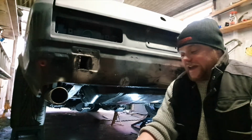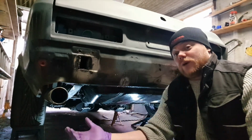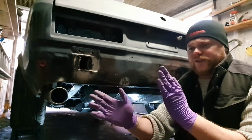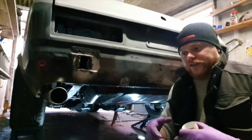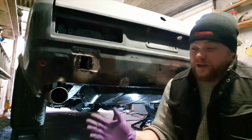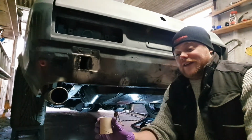The second thing is the installation of an H-pipe in the exhaust, which is basically just a pipe which links the two exhaust banks together. And what that accomplishes is a bit of a scavenging effect, so both heads of the V8 can share the same exhaust, and the theory here is that the pulse from one exhaust can actually help draw gas from the other. I'm not sure how true that all is. People go crazy into what's best, H-pipe, X-pipe, straight, whatever. I just know that they sound better.